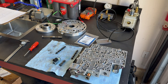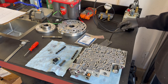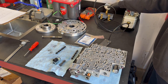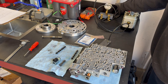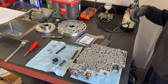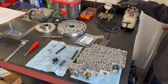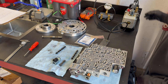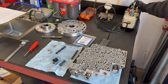I'll turn on the machine — it's already calibrated. How you calibrate it is: take your test hose or lead, stick it in the calibration receptacle, fire it up, then adjust your bleeder valve until you have a steady reading of 5 inches of calibrated vacuum. Then plug the orifice on the side of the block — that will cause the needle to jump toward 25 inches. Adjust the bleeder valve to get 25 inches and adjust the pump valve to get your baseline 5 inches. Just wanted to hastily cover that so you know there is a calibration procedure.